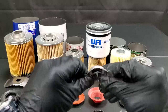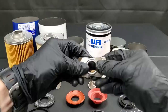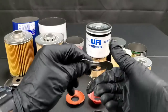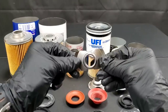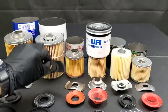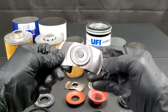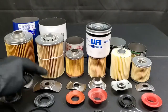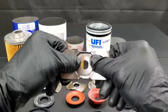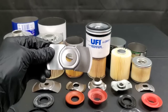We've made it to the Honda. You can use your typical stamped piece of steel and a plastic or nylon poppet. Now as for the stamped steel for the Nissan filter — made in Mexico — this stamped steel seems to be the strongest so far out of all of them. I've seen these before like on this Motorcraft stamped piece of steel and it's pretty flimsy, not as strong as the Nissan. For the AC Delco, yeah, it's definitely somewhat flimsy as well — just like a pop can tab. Not very strong.